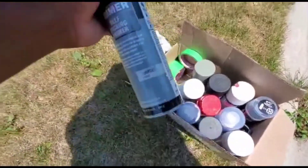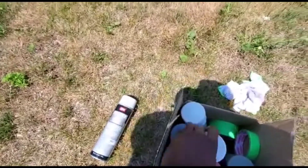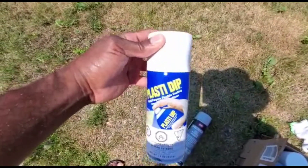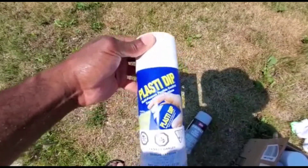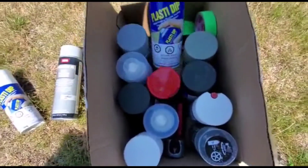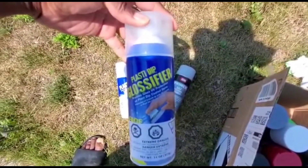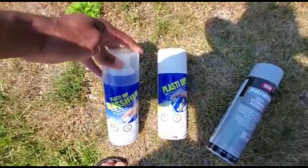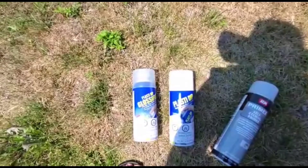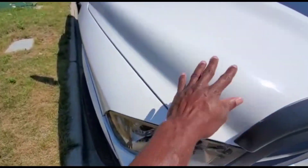Here are all my products. This is the primer I used — I got that from Amazon as well. Then we're going to be using Plasti-Dip, which is peelable. So if you plan to sell the truck and the buyer prefers chrome, you can just peel it off and they'll have chrome again. After I apply the Plasti-Dip, there's also this glossifier I purchased. What this does is give it a little shine or sheen — a glossy look — because the Plasti-Dip is matte white, just a flat base. I wanted a little sheen, so after the white spray I'll apply the glossifier to match the sheen of the truck.